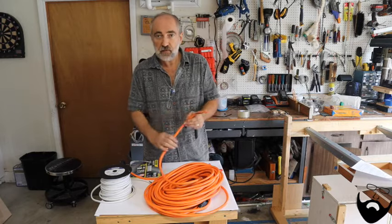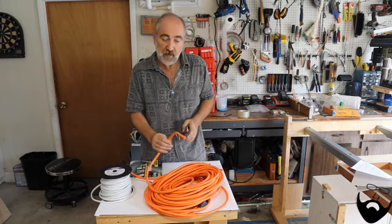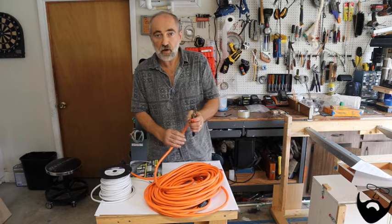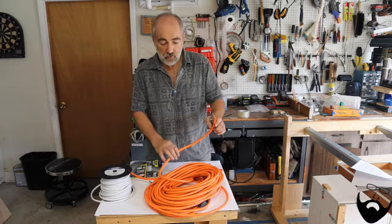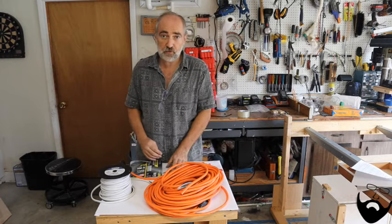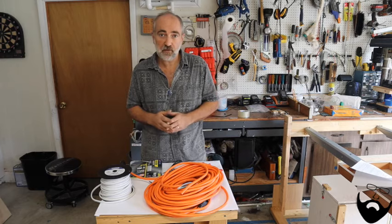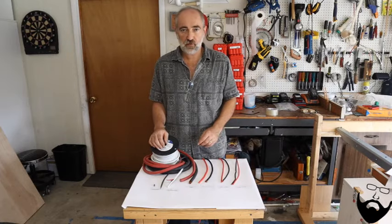That's what I'm doing — you might decide to do something a little bit different. I highly recommend that you don't go with a thinner or different gauge wire. Stay with your 12-gauge or 10-gauge wire. 10 gauge is pretty expensive, but you should be safe, happy, and have high reliability in your electrical system. That's all for the introduction to wire sizes and the wire that you'll need for your conversion van.